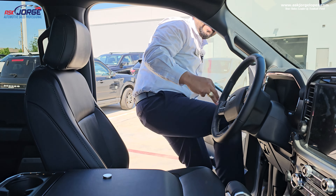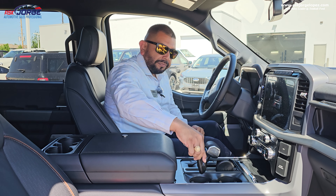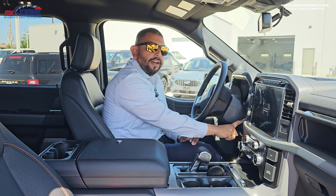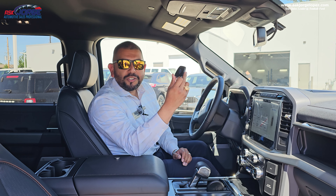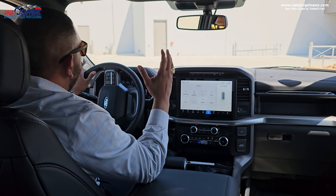I'm going to put this back together and show you that the truck is not going to start. Push the button — key is not detecting. Lock and unlock is not working. The tip and trick is to remove the bottom cover to reveal a hole in the cup holder. You place the key inside of that hole, as you can see right there, and now the truck should allow us to start up. Boom — and that's with a dead remote control.